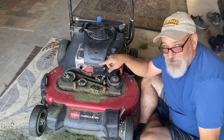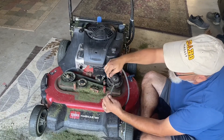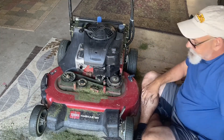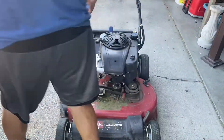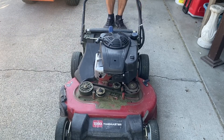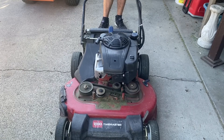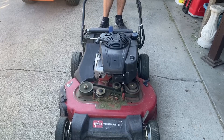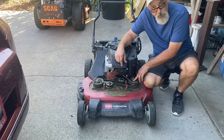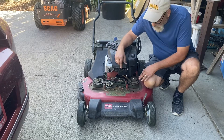Those who have been around my channel know what I'm talking about. There's the little belt right there guys — you can see that thing is just hammered, look at that thing. Oh my gosh, that's bad. All right, let's fire it up. There you go guys — that's how you replace the v-belt that drives the blades. I think they call it the brake belt or the blade belt — I'm not sure, but anyways, it's replaced.